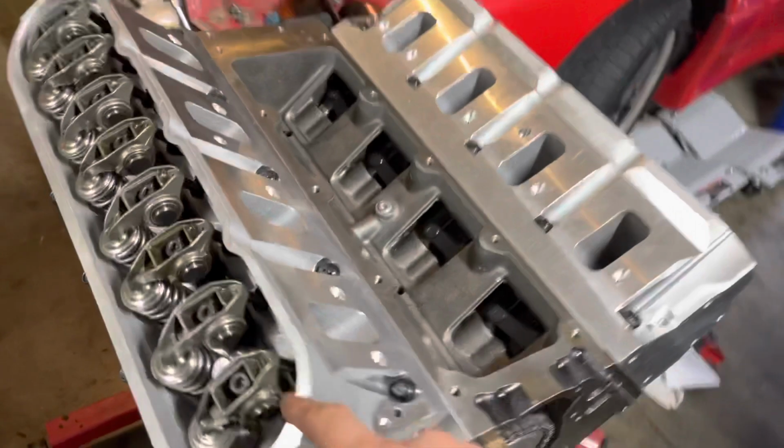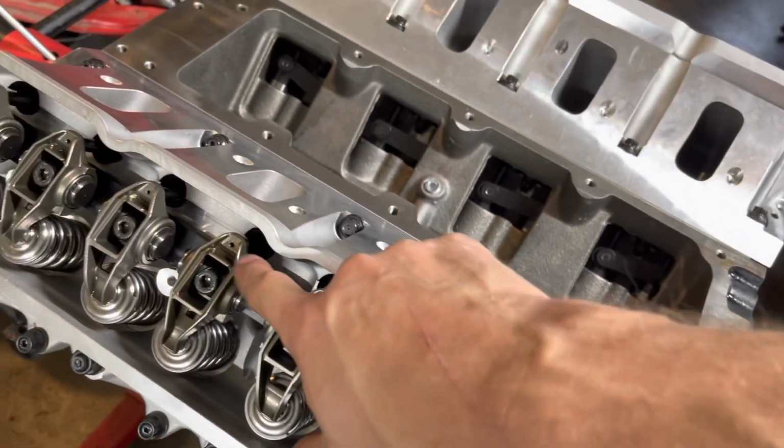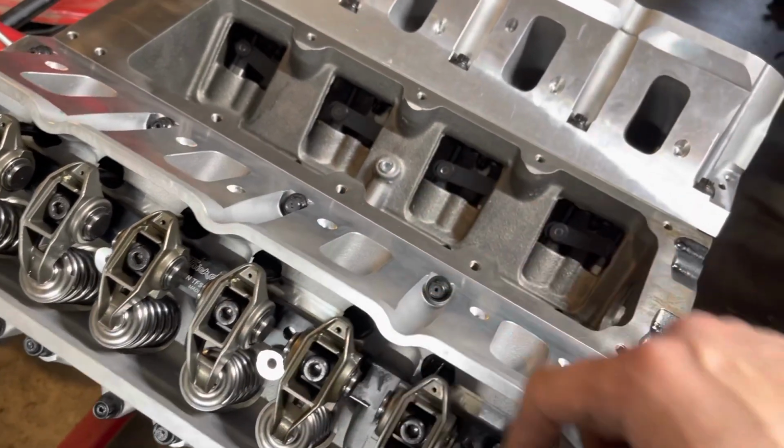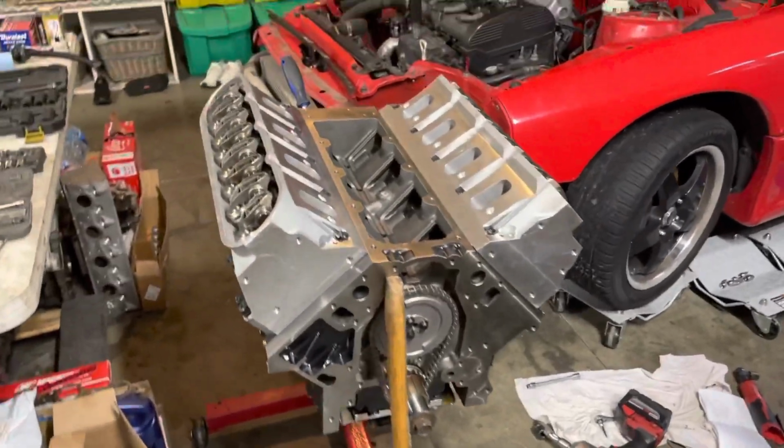We're set. The 5/16's clear better. The 3/8 took a little bit of clearancing on each intake one. Exhaust cleared fine, but 5/16's clears no problem. The .105 wall. So they said, my spring pressure is 420 open, 420 pounds, and they said that .105 5/16 is good for like 600-700. So these are good even if I upgrade springs, cam, lifters, stuff like that. So that's good.